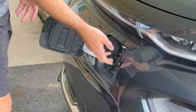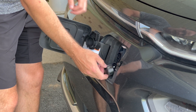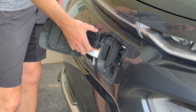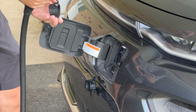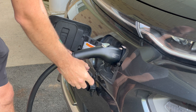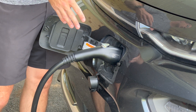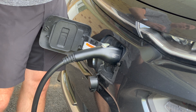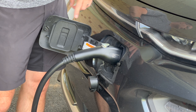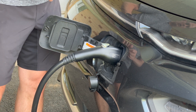Moving to the vehicle: pop the charge port door open. On the Kia Soul EV there's a level 1/2 plug and a separate level 3 port — for level 2 charging at home, just use the smaller one. Remember to use the cap to keep debris out of the connector. Plug the car in first — you should hear a click. The car should start charging. This one is fully charged so there's no sound right now. Always plug in and verify the car has started charging before you walk away.